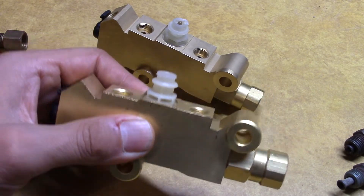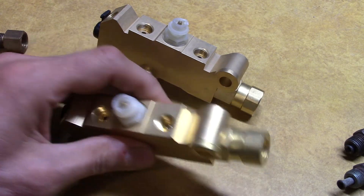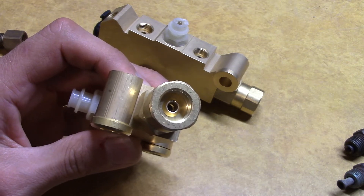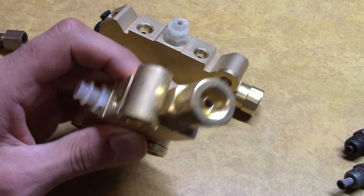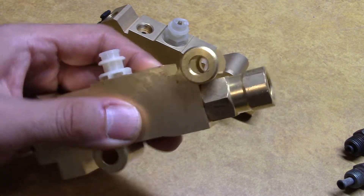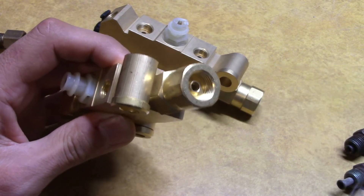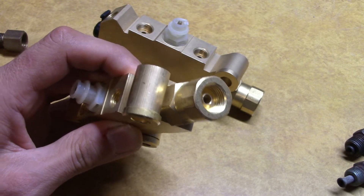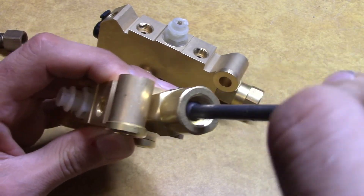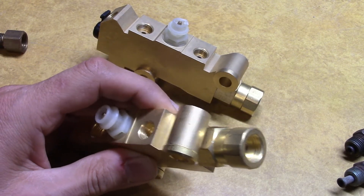That's one manufacturer carrying this for a particular application. I worked on a Chevy once years ago and they have quarter-inch line running in the back. Most vehicles do not — the one I have does not, the one this was ordered for does not — it has three-sixteenths running to the back. Be aware: that's not going to work. You need the quarter-inch line if you're working on a Chevy; that's fine, they're designed with it. That quarter-inch line locks on that cone.